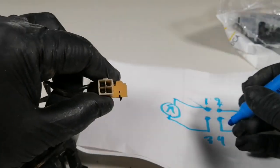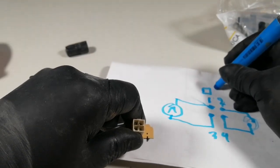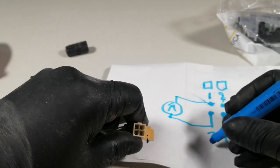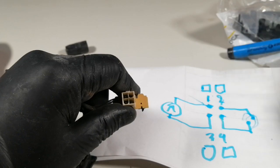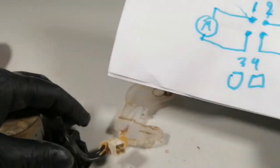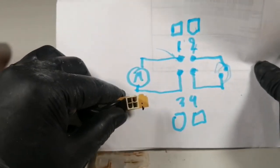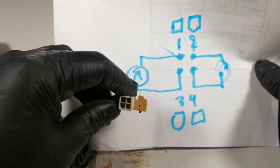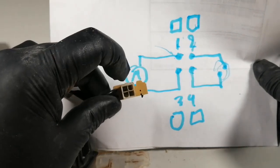It's easy. Look at the side that the motor is on. Motor is something silly, but it's easy. On the right side is the switch. Here I'm identifying it a little bit so that you can appreciate it better according to the diagram, and the connection on the right side has a little leg on the top part of the white connection. This is how we are seeing it. It would be 1, 2, 3 and 4 on the left side, motor on the right side, switch. If you are looking at it the other way around, then just flip the diagram. Okay, so it's easy to check this and everything.